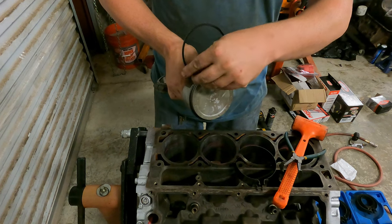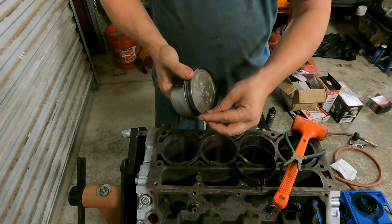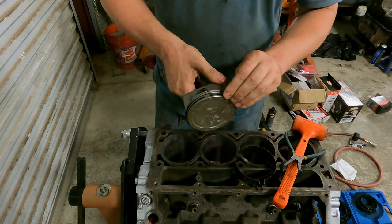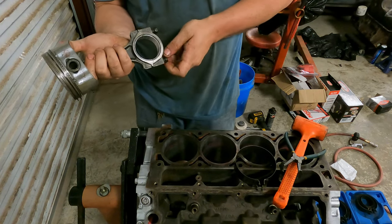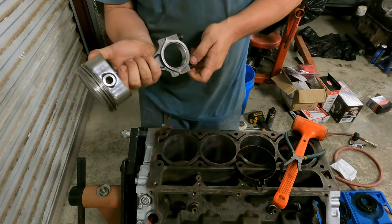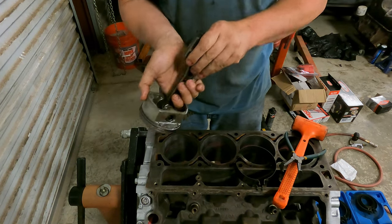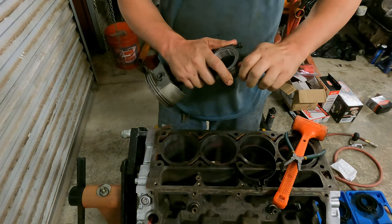All right, you'll lift his tail, spinning the ring around the piston, all the way around, and then just pick the tail up. Don't let it scratch down the side of the piston, and boom, piston's ringed. Now, we already put bearings in. Bearings are easy. I just slide lock it right into place. Y'all have watched me do that a few times on the channel if you watch the channel. If not, there's plenty of video on that, I promise. So now, we'll pull this cap off.